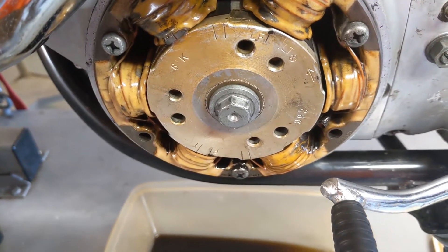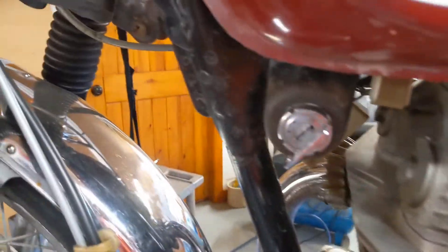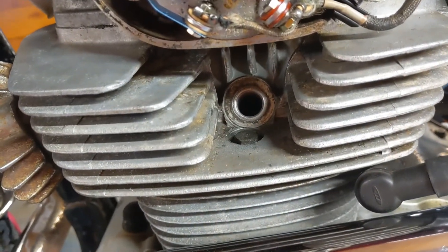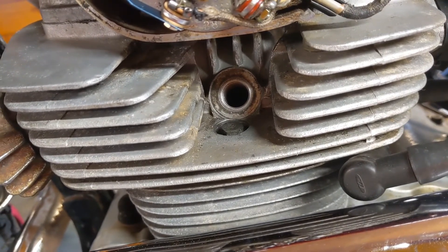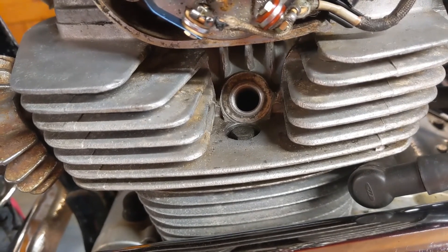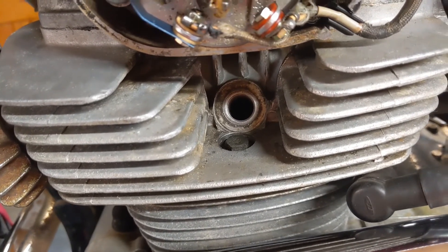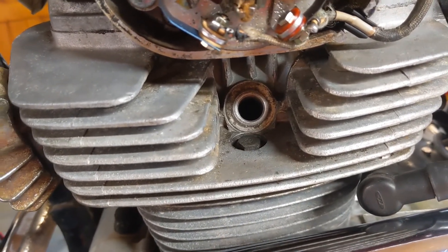You take the socket and it fits the bolt on the end of the crankshaft — that's the alternator you see behind it, but you're not trying to loosen that, you're just trying to turn the engine over. Put your index finger on the spark plug hole — with the ignition turned off, be absolutely sure of that — and with the 14 millimeter socket on the crankshaft, turn it over until you feel pressure on the compression stroke. You'll feel a little whoosh sound, which confirms you're on the compression stroke and in the right position to check the ignition points gap.